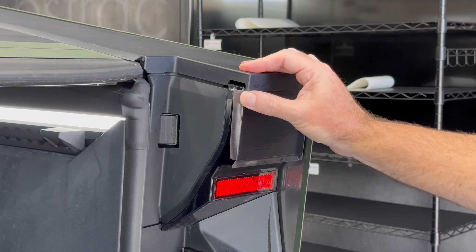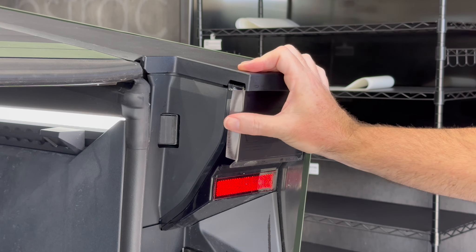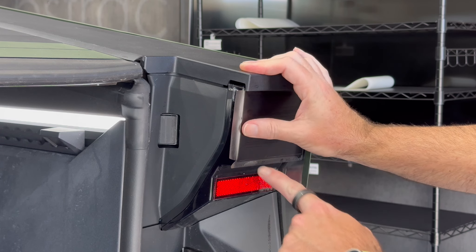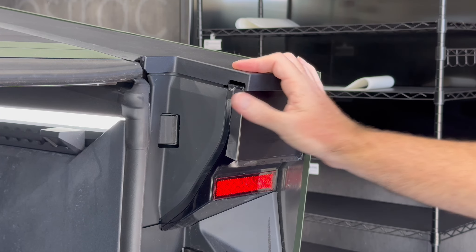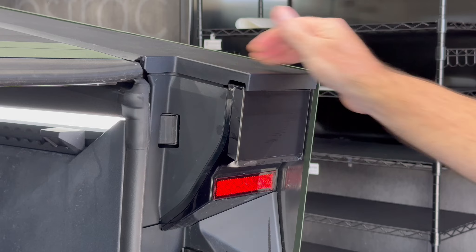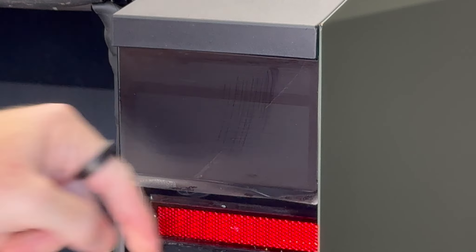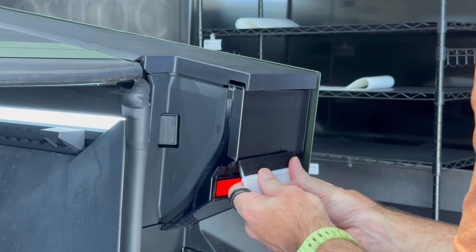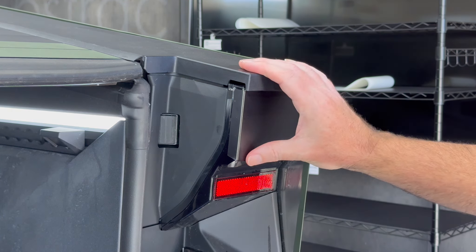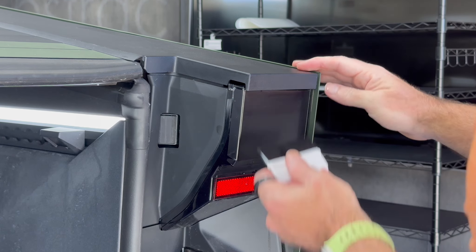I'm going to take my thumb and just roll it over the edge. Doing this heats it up a little bit — it's not as easy as vinyl but you really want to make sure that when you roll it over you're not leaving any air trapped on the front face. Just kind of stretch it over the side like that, all with your thumb. Then same on the bottom edge. There's a bunch of water hanging around here so give it a knock to get the worst of it out, then squeegee it out some more. This last piece just wraps over here like so.